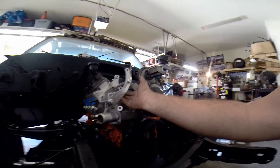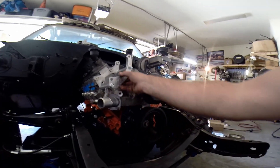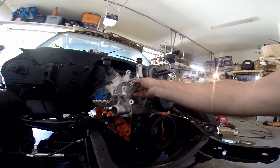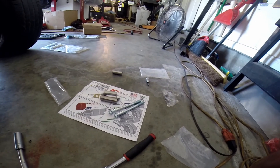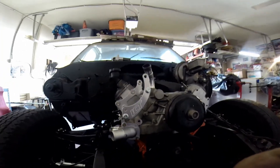Got the front bracketry in there and put the pump back on. What you want to do is get the bracket up there and then lay the alternator in, so you want to leave it a little bit loose. This is a 14mm — I think it's an M10 by 130 — and there's four of these bolts: two for the lower piece and two for the alternator.